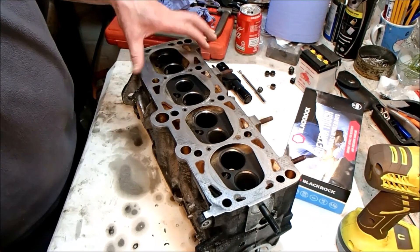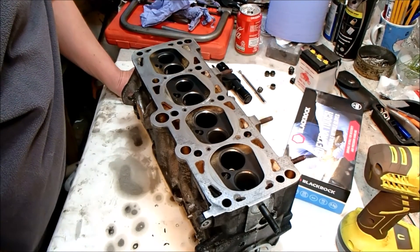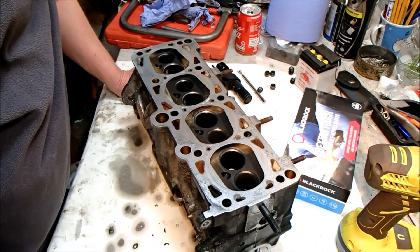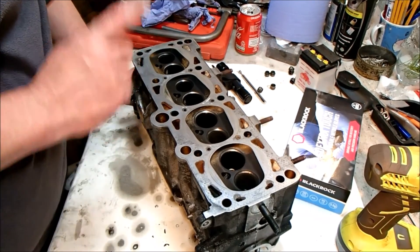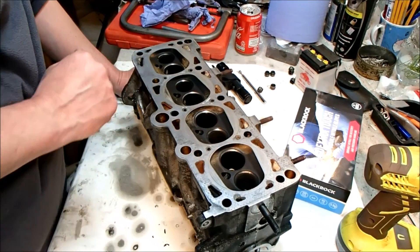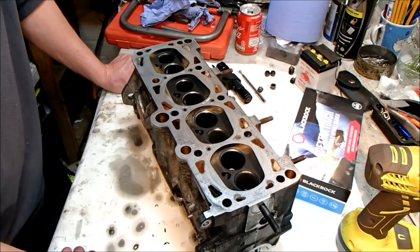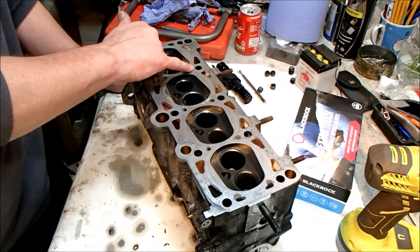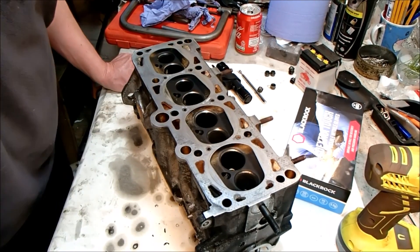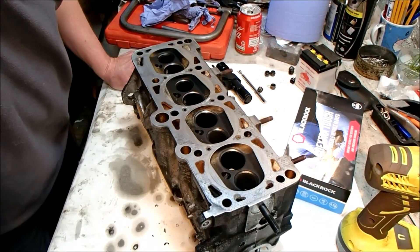After that I have to clean the rest of the head up — it's had a cursory clean but it's still pretty grubby, so it needs a bit of work. I need to clean the valves, I need to order some parts — a couple of studs and brass nuts. Then it's a case of cleaning all the crud out. Some of the carbon has gone down some of these oil ways and I don't want that being pumped out, so we're talking clean, clean, clean — then get an airline on it, blow it out, let it dry, and blow it out again.